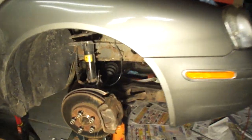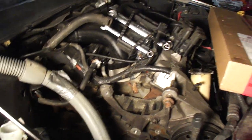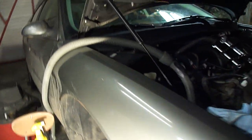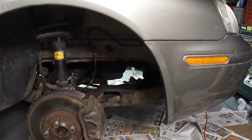Pretty much the same parts here, with massive tools laying around for different sections of the project. So now I'm going to drop this oil pan, and then I still got to vacuum off the top of the motor — got the vacuum hose in there — and clean that all up before I pull the timing cover off. I took the gasket box and marked it where all the bolts go. The repair manual doesn't say to keep them in order, but from past experience pulling pans, there are different lengths of bolts in different areas, so I want to make sure they go back in the original place. I'll get a video once I pull the oil pan and then the timing cover.